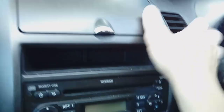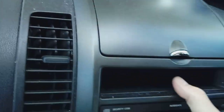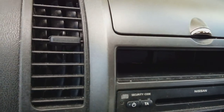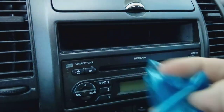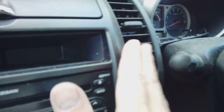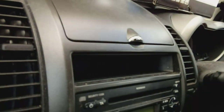Pull it forward — give it a bit of a tug. You might want to cover your gear lever so you don't slide anything down onto it and damage it. I just use a little poly bag as a bit of padding to stop everything getting damaged. When pulling this out, pay attention to the fact you're right near your stalk control, so you'll have to maneuver around it. All the clips have come free and there are also wiring connectors still attached.